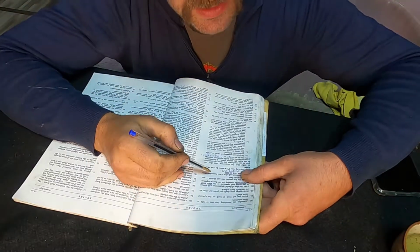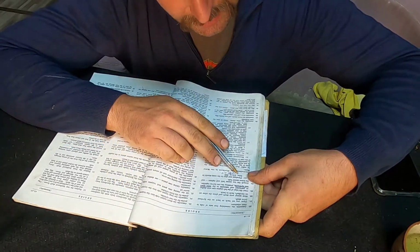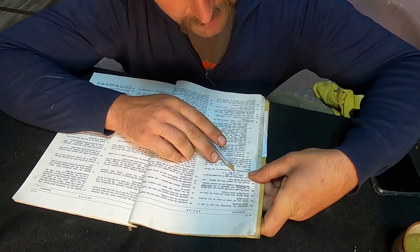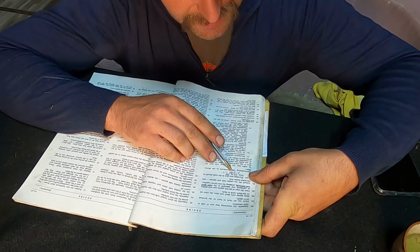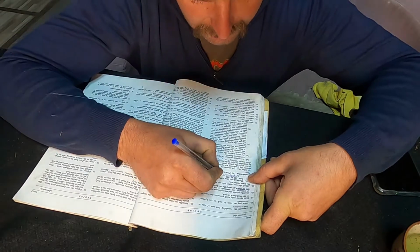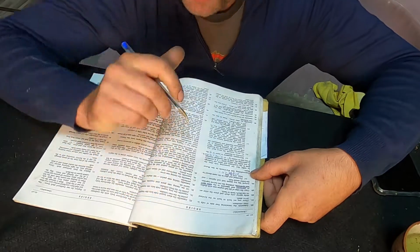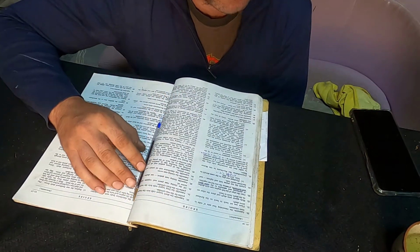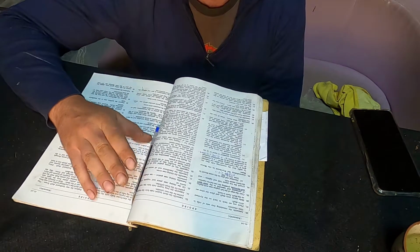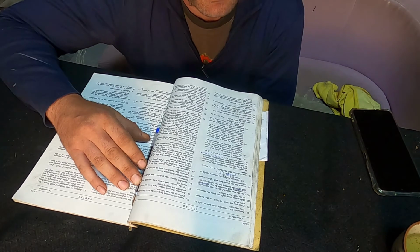I was checking the side play of the flywheel in the cases and they say it should be 0.015 inches or 0.38 millimeters to 0.5 millimeters. So I will take 0.4 if I can have it precisely done. But first I will take the thrust washers for a heat treatment and hope to get them back today later. I have a heat treatment factory quite close by.